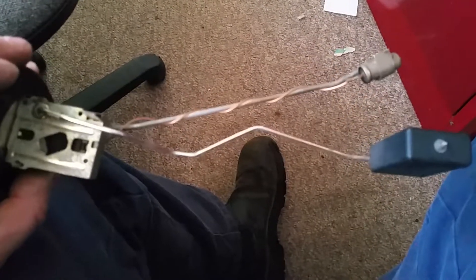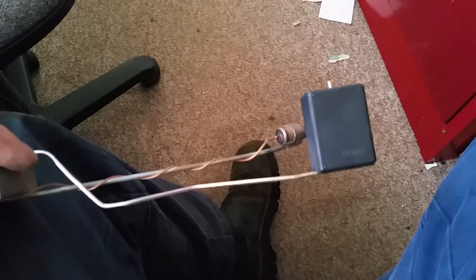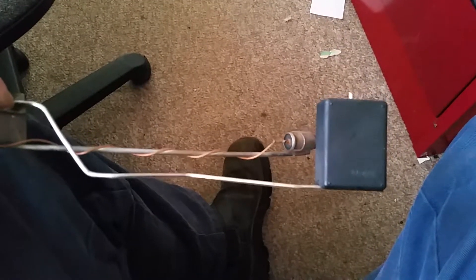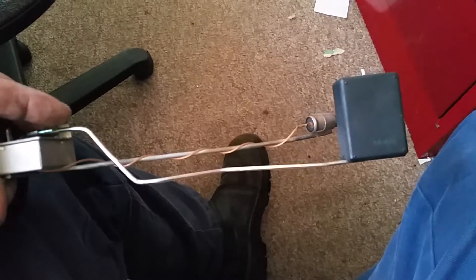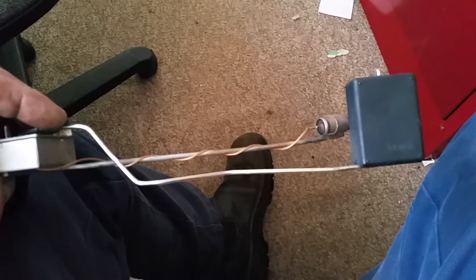Just a quick video to give you an idea of how I've modified the shape. It's been bent over on this side to the bottom of the screen, so the float is centered over the sender — purely because the auxiliary tank has the full fuel pump splash guard in the way and the float rubs against it.